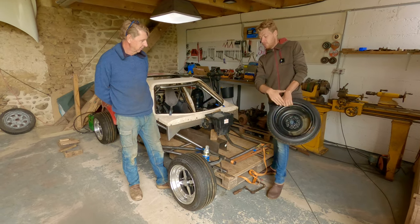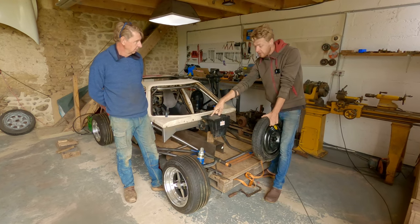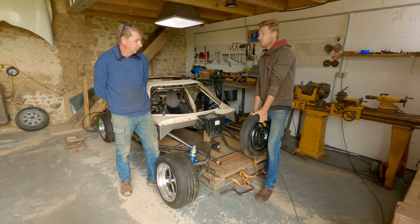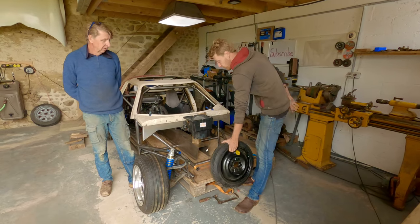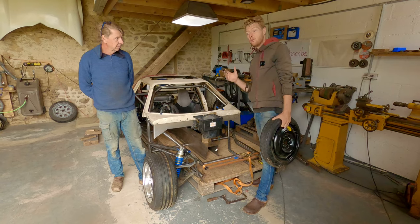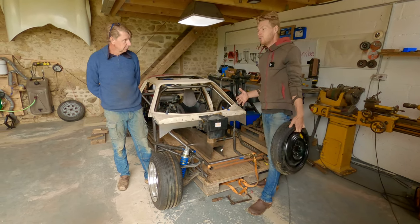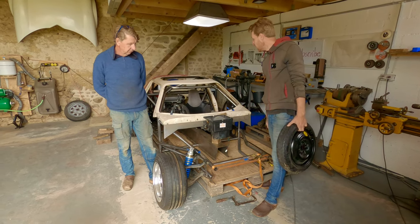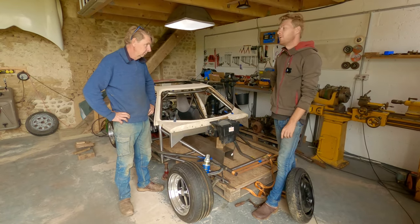But if we put it in front, then all of the weight is on a lever from the center point of the wheel forward. So that 9 kilos becomes the equivalent of 14 kilos plus, and we can actually work that out mathematically and help us to weight balance the car accordingly. And so we're not adding weight, we're just moving weight around in order to get the weight balance correct, which is ideal. What were we talking about? Anyway, let's make a chassis.